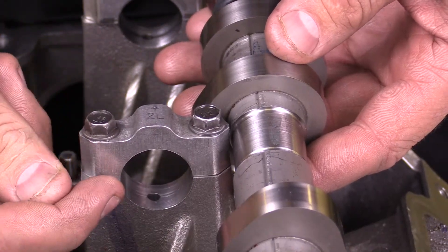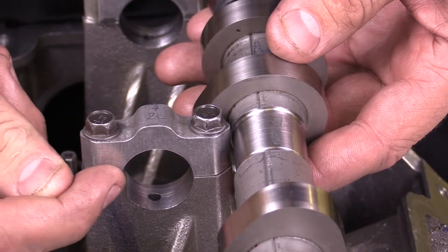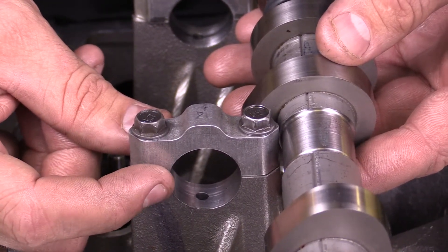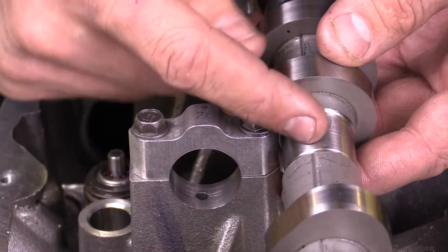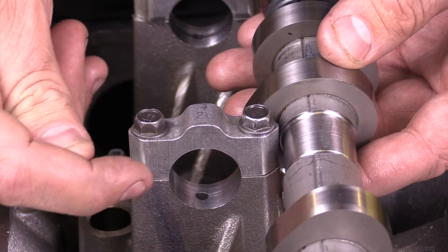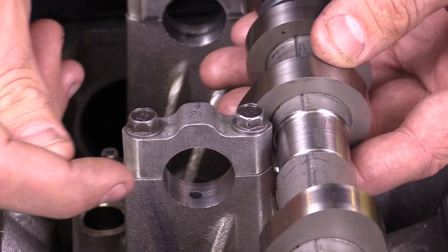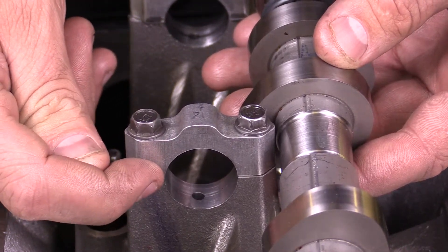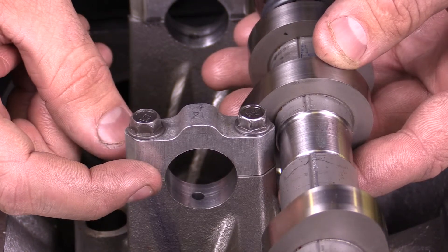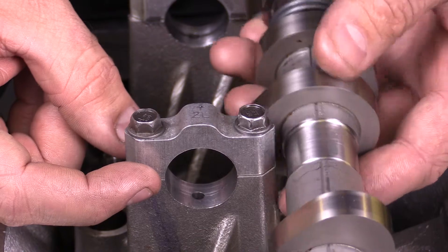I want to be very careful when measuring the bore. A lot of times people make the mistake of saying the bore is actually smaller than the journal, which is impossible — this goes inside of this. So when you've made your measurements, compare them and make sure the bore number is larger. If the bore measurement is smaller than your journal, you've done something wrong, probably in setting up the telescoping gauge itself.